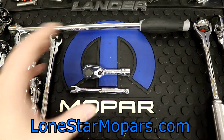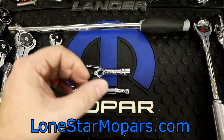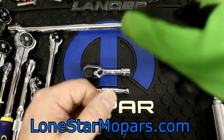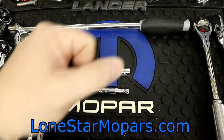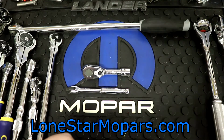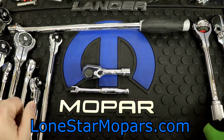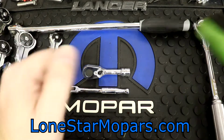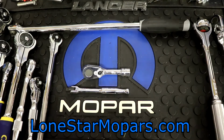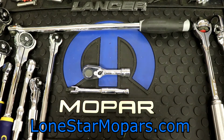You might see him with an extension, right? We're going down, think of a thermostat housing, and he sits there, slaps the ratchet, breaks it free, and then while you're sitting there ratcheting, 90 degrees with the extension like this, old man detaches his ratchet and he just spins his extension, and guess what? He gets it out before you. He probably breaks one, breaks two, runs them out with an extension, and you're over there still ratcheting, trying to get the first bolt out.